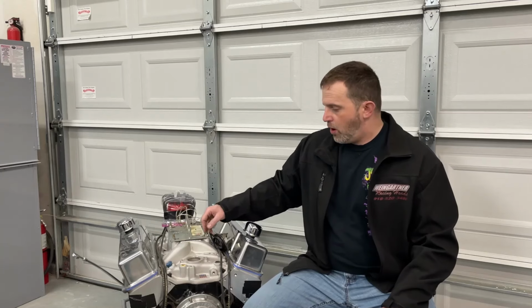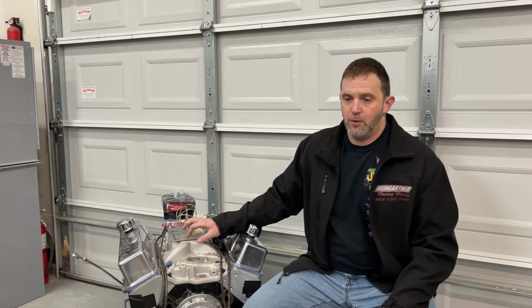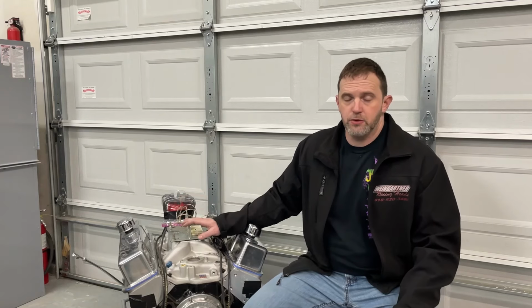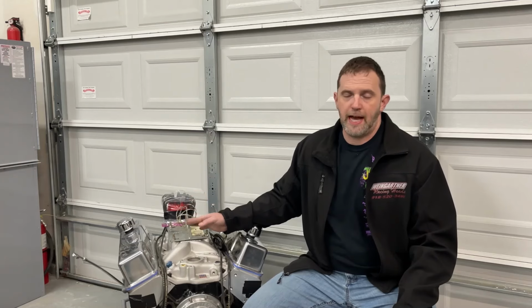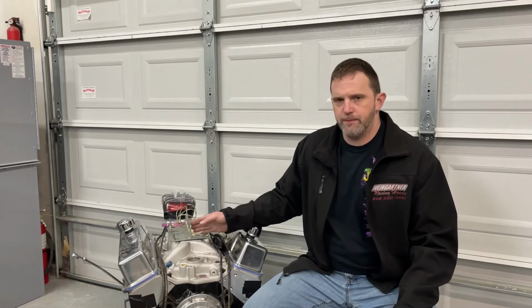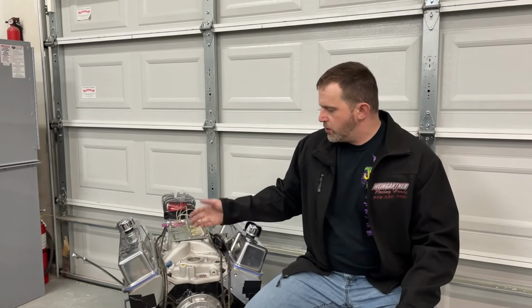There's only one more thing I want to try, and then let's just get it off. I want to take out the spacers. So all we did was take all the spacers off and put the carburetor directly onto the manifold with no spacers. The reason for it is, I'm not entirely sure she's having enough hood clearance anyway for a spacer. So I want to see if it's going to lose a bunch or whatever it's going to do. I was just curious. And that would be our last pull, which we didn't back up because it was super quick. The oil temperature and water temperatures were pretty close whenever we started. So took it off, put it back on. Here's that video.